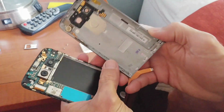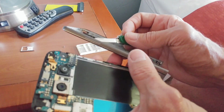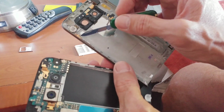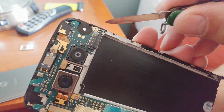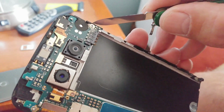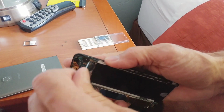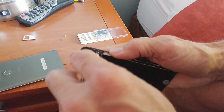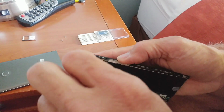And voila, this is the volume control button here, and believe it or not, it's usually not the problem, but these contacts up here are. They're usually not pressing hard enough against the terminals on the circuit board right here. So what we need to do is raise where this screw is so that there's more pressure on those contacts. These phones sit in windshields and they get vibrated quite a bit, and over time that's what happens as these contacts lose pressure. You'll see it's a very common problem.